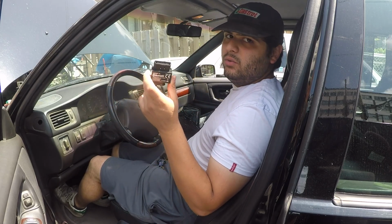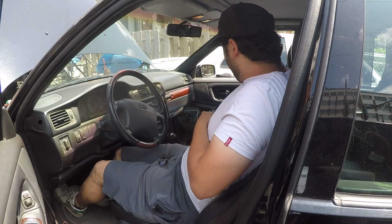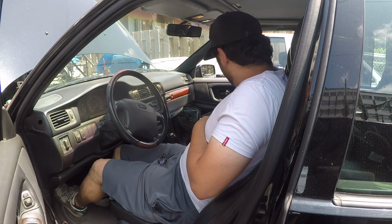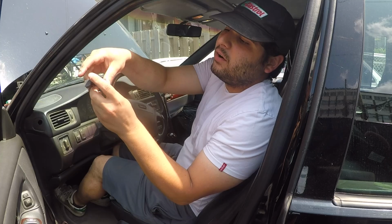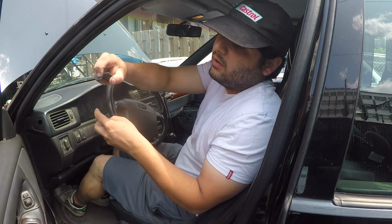So the first thing you got to do on these cars, there's no scanner underneath. On P80 cars, it's located in the armrest, and then you'll see a cover right where your trim comes in over here. You'll see a little cover, and you just got to pop this out by pressing like this on the side. The cover is going to be like this in the car. Just press here, there's some little finger grips. Press it like this and it depresses the clip and you can pop it outwards.